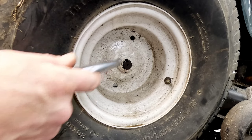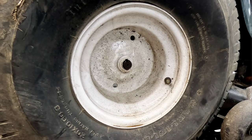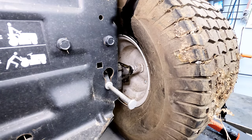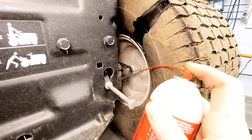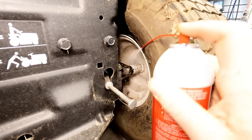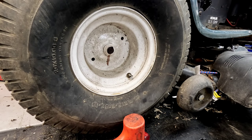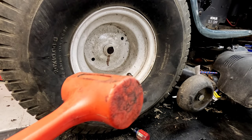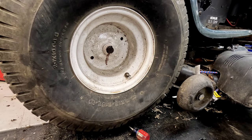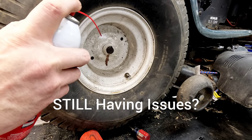If you get to a point where it gets stuck and will not move anymore — that's the case a lot of times — you want to stop, pull everything out, and spray some more fluid down in the backside, getting it all along that shaft. You should have a bigger gap now where it'll get in further. Once it's there, go ahead and hit on the rim to push the tire right back to where it came from. That gets the fluid we put in the backside between there and along that shaft even more. Then spray the front a little more.